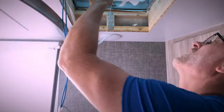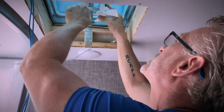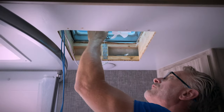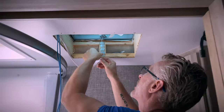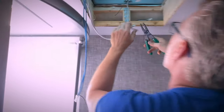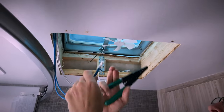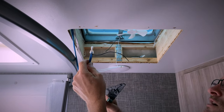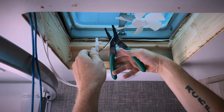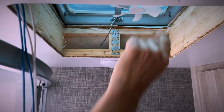The next thing we have to do is take this fan out. It's pop-riveted on here, so I'm going to use a flat head screwdriver and pry this away from that bar because it has to come out. Now, the white wire on this is more than likely the neutral or negative side of your DC connection. You want to leave yourself enough room here to splice into this for the hot side or positive side. Cut it back here to give yourself plenty of room.